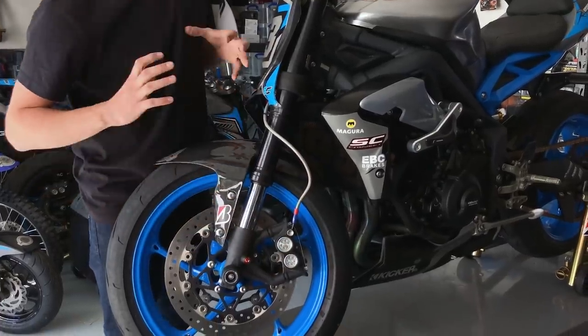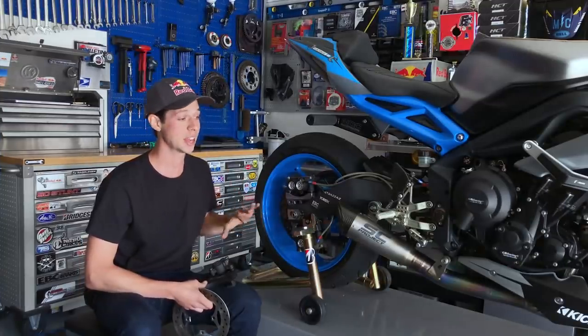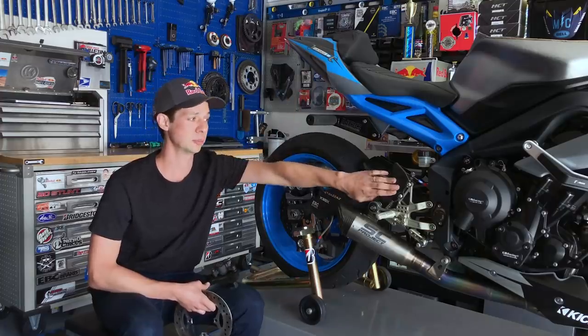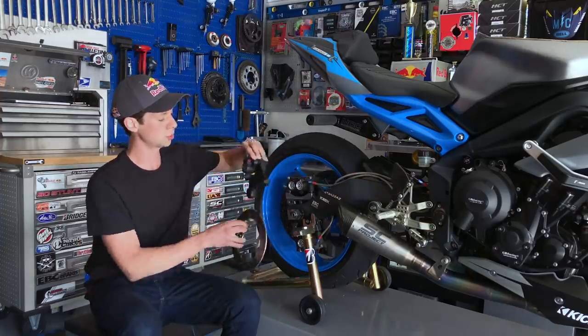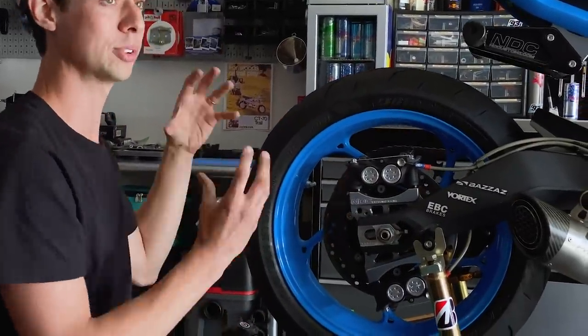This whole setup is about as much as I can ask for out of a sports setup. So in the early days of stunt riding, the handbrake setup was very simple. You took a master cylinder at the handlebar, you tied it into the foot brake master cylinder, and you used the stock rear braking components for your handbrake. Things have literally grown since then.